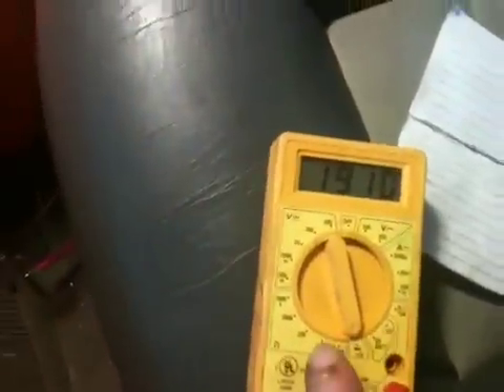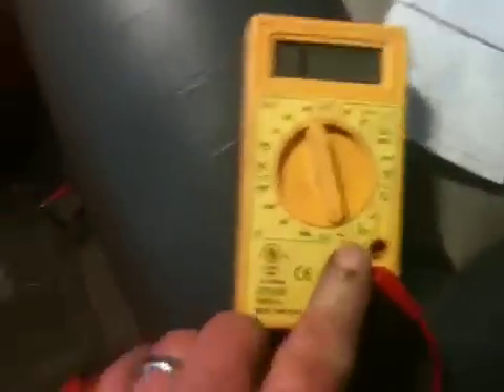Some cars I like to run a little tighter than the outside marks. Somewhere around five inches, but five and a half is a good starting point and you can adjust from there according to your car. So, I'll turn my voltmeter to the continuity setting — it'll ring or buzz whenever continuity is made. With my timer set to center, I'm going to slowly rotate my flywheel around.